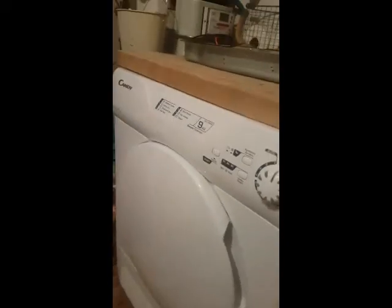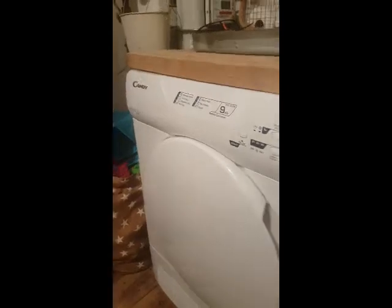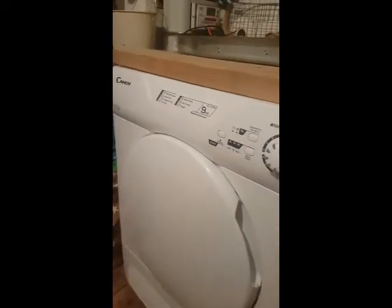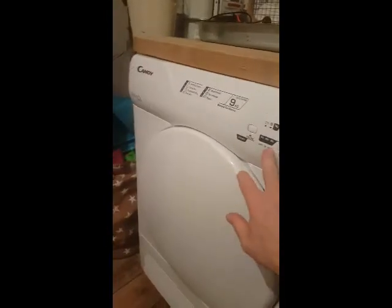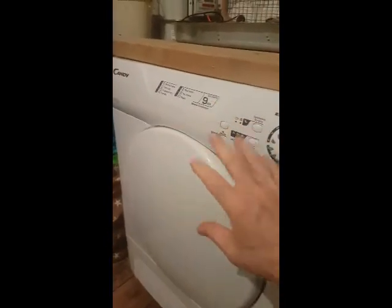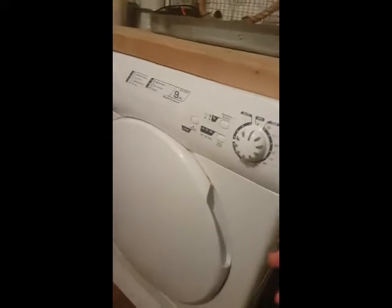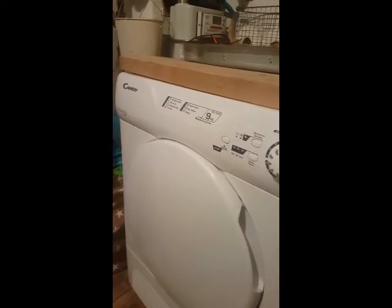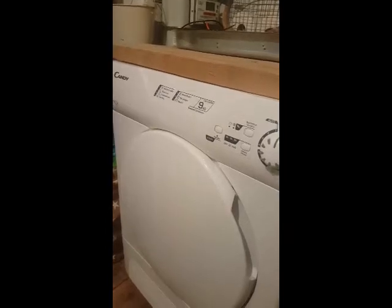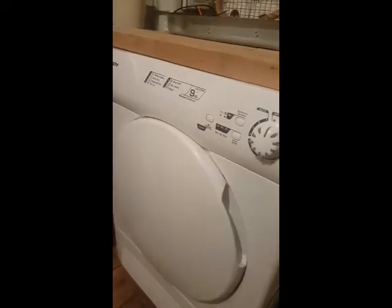Right, this video is for when you no longer have any heat in your dryer, so it spins, everything stays wet and cold, and all the lights on your panel flash at the same time. So what I'm going to do is pull the dryer out, get at the back of it, unplug it, and do a continuity test.